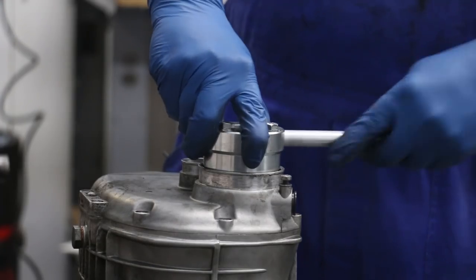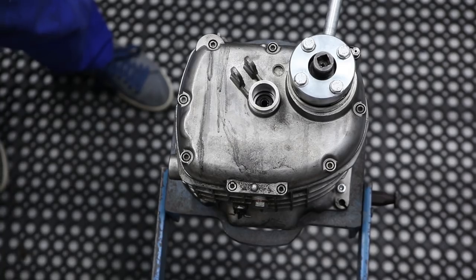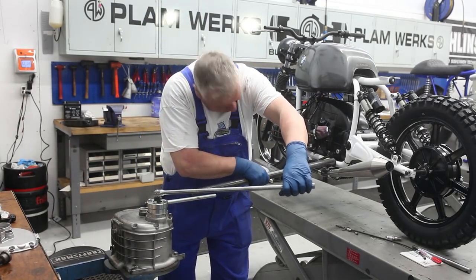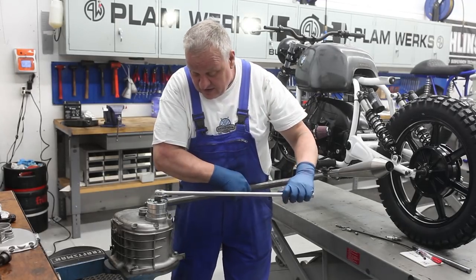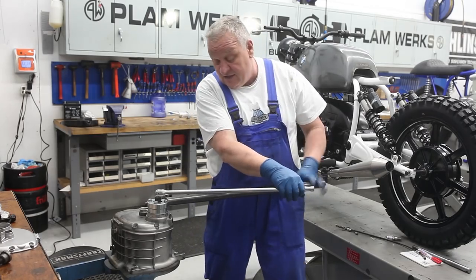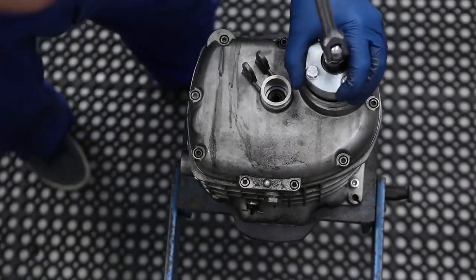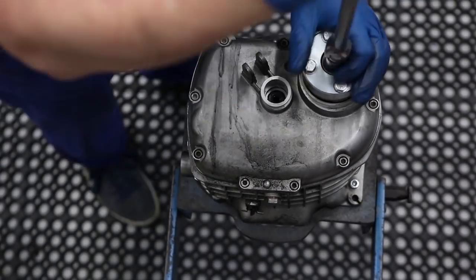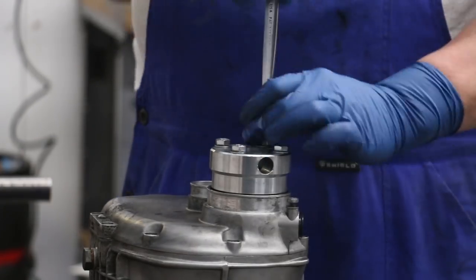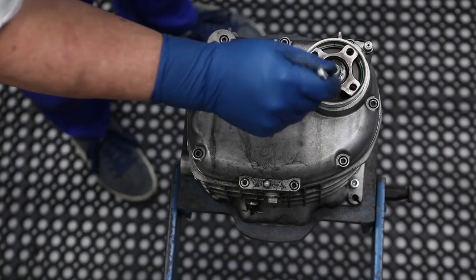A bar is inserted to hold the flange still, and then you need a 24mm socket that fits right inside. They're pretty tight, so a good-sized breaker bar is nice, and I like to put a piece of tubing on it as well to break that thing loose. Okay, so that's step one — loosening the nut. The tool comes back off, and there's a little wave washer in here that I'll get out too.